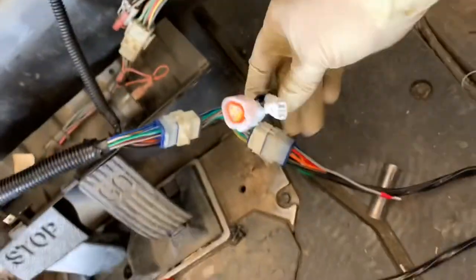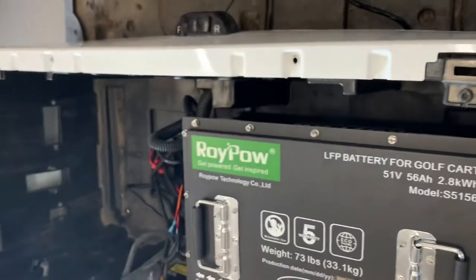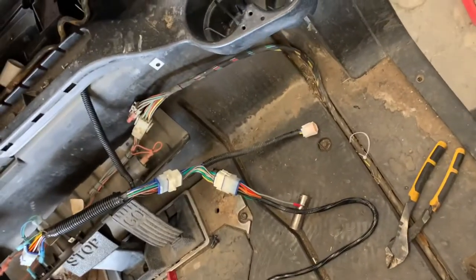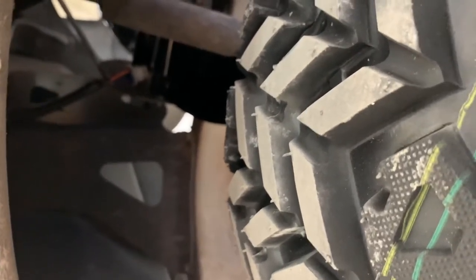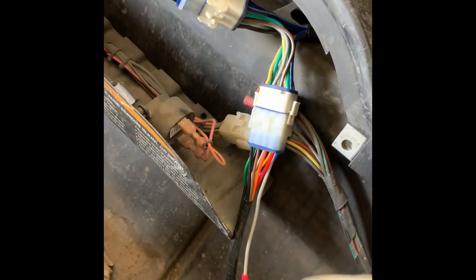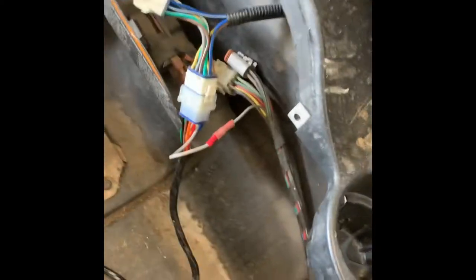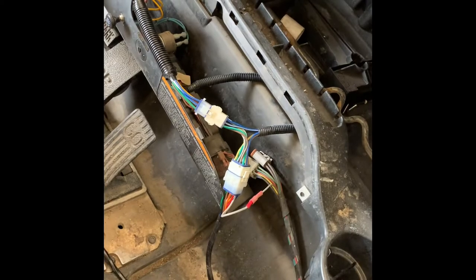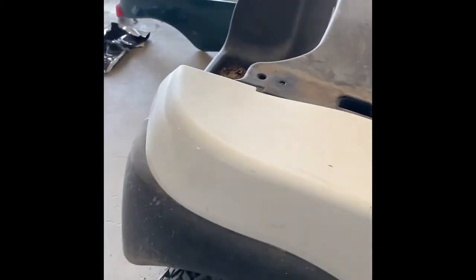So we have the voltage reducer harness — you can tell it has two plugs on it. We're going to run this to the front because that's where I like to mount it, and it's plugged into the bucket harness which runs back into the battery tray. I'd like to mount it down in the wheel well because it's easy to access if it ever fails. Now I've run the wires to the front. If you were going to run a deluxe light kit, this gray wire has to be plugged in — it plugs into the factory harness right here to this gray wire. Now I'm putting the dash cover back up and we're pretty much done behind there. Everything else will be in the front of the golf cart, battery tray, and taillights — we're all done in the dash.